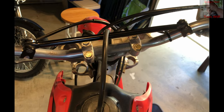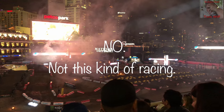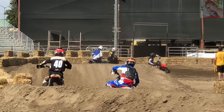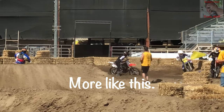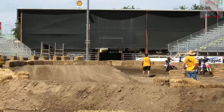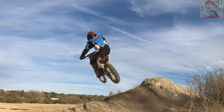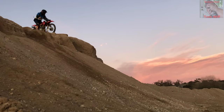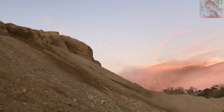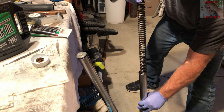A little beat up — it had seen better days. I actually did go out and race the thing as-is, and that turned out to be a big mistake. So I went back to the drawing board. First off, the jetting and gearing was way off. The suspension was soft as a heated marshmallow in July, bottoming badly on every jump. So fixing the power delivery via jetting and gearing, and stiffening up the suspension, was first in order to keep my 190-pound body from slamming into the gas tank again.